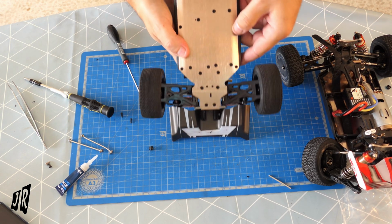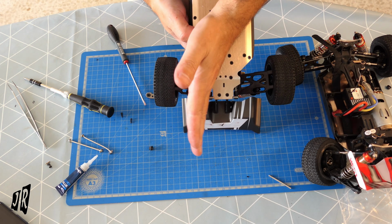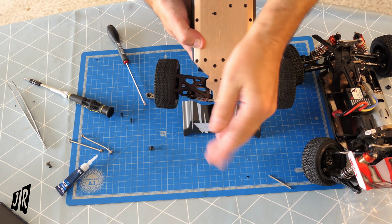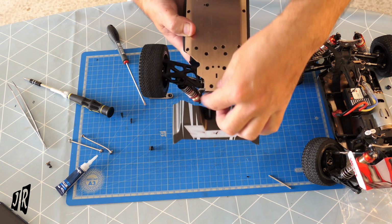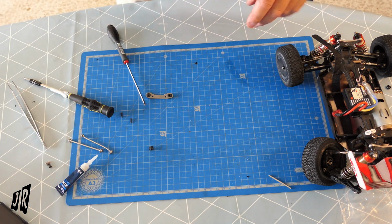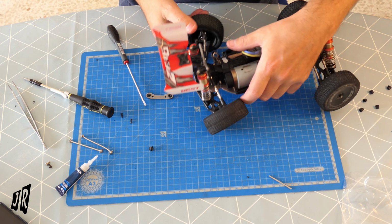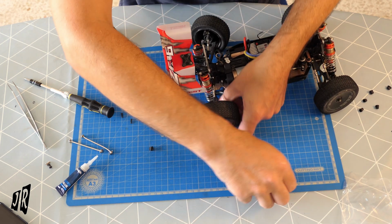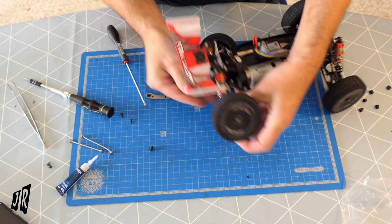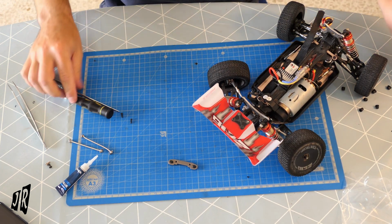If you look here, you see how where their bracket is, they've got it on the outer setting, it's out, causing the wheel to sort of point inwards. So if we put the bracket the other way around, this little stopper, it'll pull that in and therefore straighten the wheel up. And then we'll be able to do a direct comparison between the two and see which is better. So that's that done, so I can forget that.